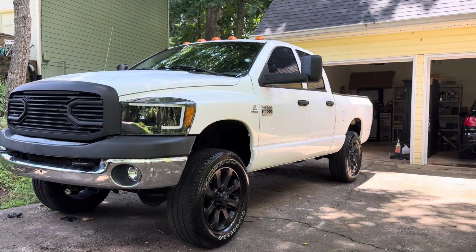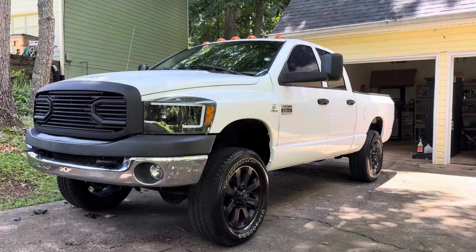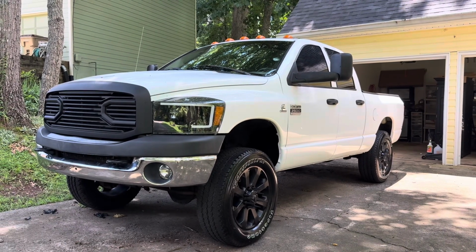I'm also into first gen Toyota Tacomas, and I'll be coming out with a video with that shortly, right after this one, with a little bit of, I guess, what would it be? Like a sneak peek into what's coming. My video cut off, but to just sum it up, it's a sneak peek at a second generation TRD supercharger. It's made by Magnuson, and it's for the first gen Toyota Tacomas from 1995 to 2004. The charger in specific is for '97, I think, to '04, or '96 to '04, but you can put them on the '95s, the first 3.4s that came out from Toyota. You have to modify it a little bit, put some of the newer model parts on the older model engine, and it'll run with the charger. But that's a little sneak peek.